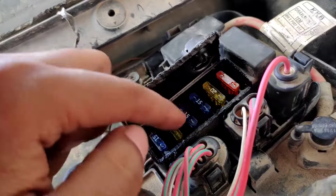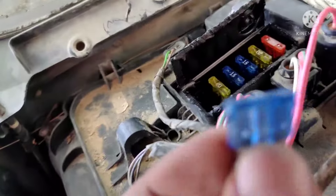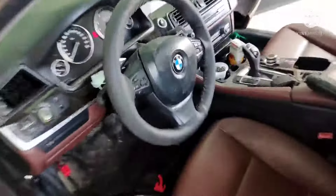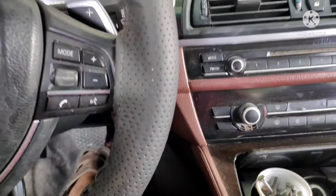Under this cover, I found the first fuse. As you can see, this is the problem with Terminal 15 and Terminal 15 no voltage. I just replaced this fuse and the car starts very well. I will show you — because many people on YouTube just talk about Terminal 15 and 15.3, but no one shows you how to actually fix this problem.